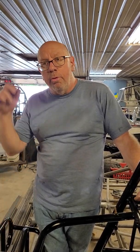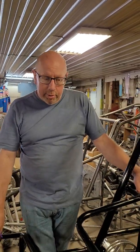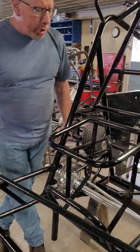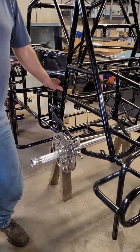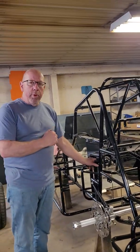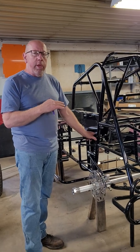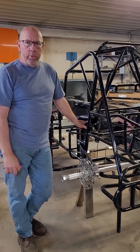This is just all the thought process that I have to go through when I build a car, and it's so much more than that. Like our wishbones. If you look at our wishbones, they're shorter than a normal micro sprint. The reason why is that it hooks a car up harder. With my heights, how I have the motor location, the height of the motor, everything I do is to get forward drive out of the car. We hook up hard compared to a micro sprint.